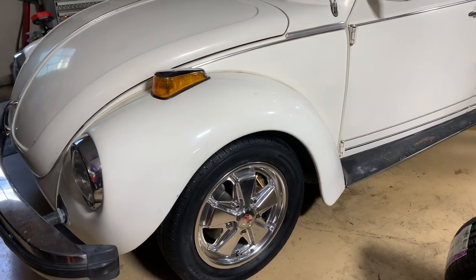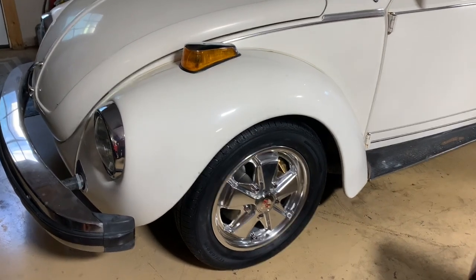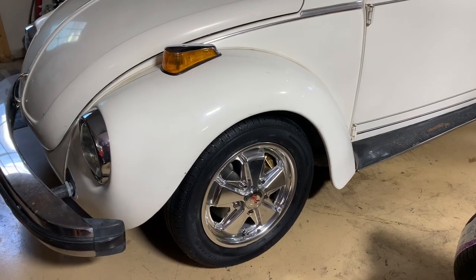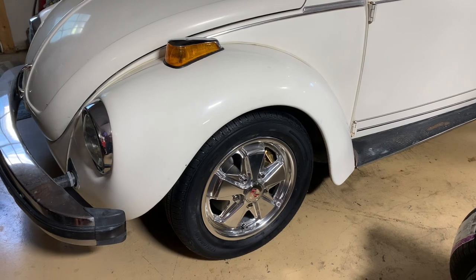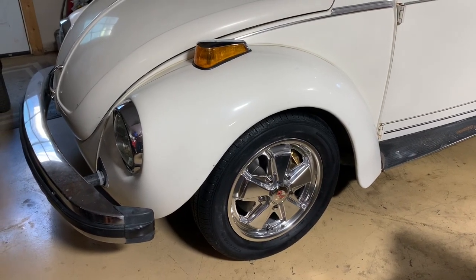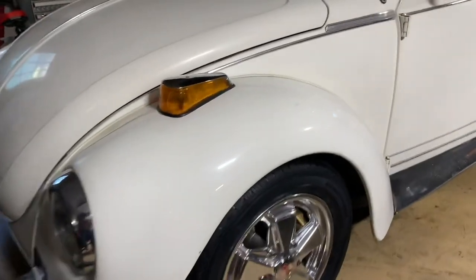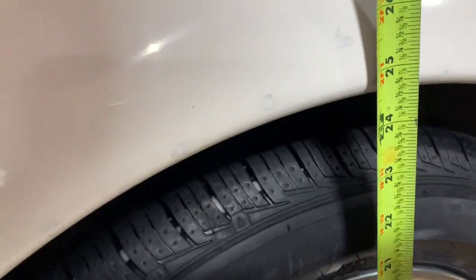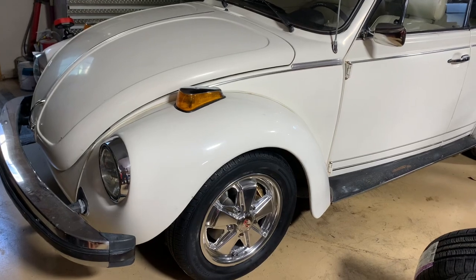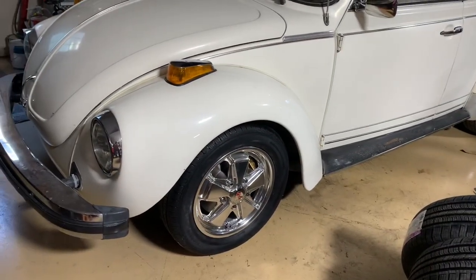I'm done with the front - I'll save part two for converting the rear to the five-lug Porsche bolt pattern. My goal was to be at about 24.5 inches and we started at 28, so we were going to drop the car three and a half inches. I got cautious and moved the lock ring up one notch to add back half an inch, because the tire size is an inch and a quarter lower than stock. That was a good call - we started at 28 and now we're at 24.5 inches, right on the money where I wanted to be.